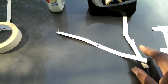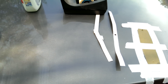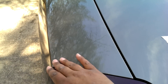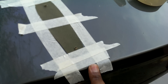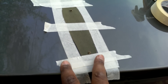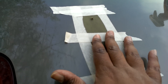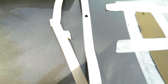And it's good to go. It's a lot easier than using these little shims, whatever you call these little things that come in the pack — little templates. So make your own templates, you come out a lot better. Again, 15 and a quarter from the end to this point, an inch from the back of your trunk lid to here. Tape and make a template right here using the bottom of the spoiler, use that as a cutout, place that on here, tape these three points to keep it held in place. And it's that simple, it's good to go.